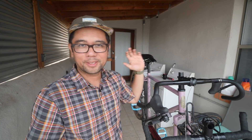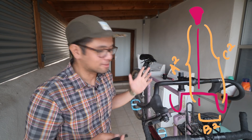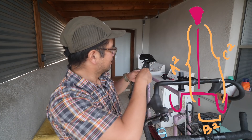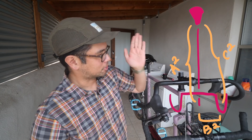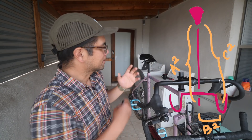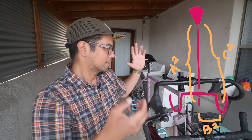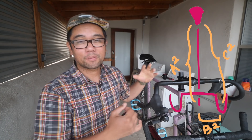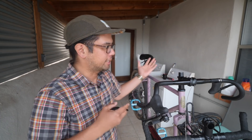So we're going to use the Pythagorean theorem to solve for this diagonal measurement of reach. One of the reasons I didn't do this initially is, you know, English major. Also I felt like I couldn't get an accurate measurement of this side here, because I'd have to measure from the tip of the saddle through the steer tube and floating in space trying to capture where this first hash mark intersects. These numbers will change relative to how your bike is set up, so they aren't meant to be gospel but just a means to figure out the delta when you change a wider handlebar and how it affects reach.